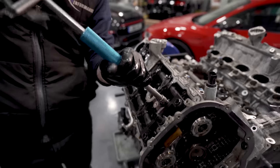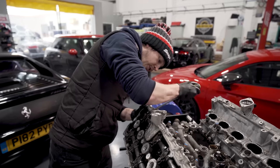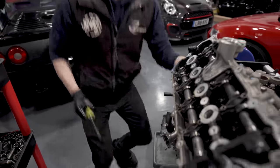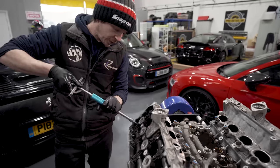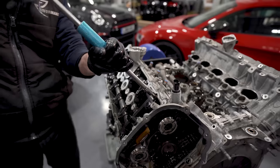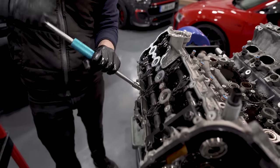And if you didn't do that, what's the worst case? The worst case is you get the screws out loads and loads, and then the glue goes and it jumps. So it takes a big shock. And the problem there is, one, you've either got them so far out that you're holding a cam bridge in your hand and you damage something, or two, it throws bits across the workshop. There are screws that hold the cam bridge on. As long as you've got some control, some balance, trying to keep the cams as straight as you can, taking them off.